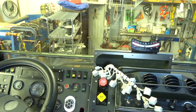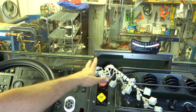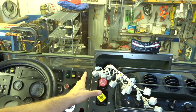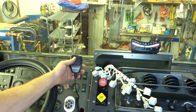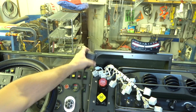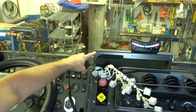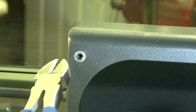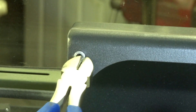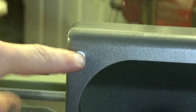Now you might be thinking — didn't you just put that trailer supply system in and it was already all put together? Well, it was. Until I started putting the CB radios back on, I thought I'd be able to clip it right here. So I started putting the clip on this bolt, and the rivnut decided to start spinning in place. So I'm going to have to drill this out and put a new rivnut in.